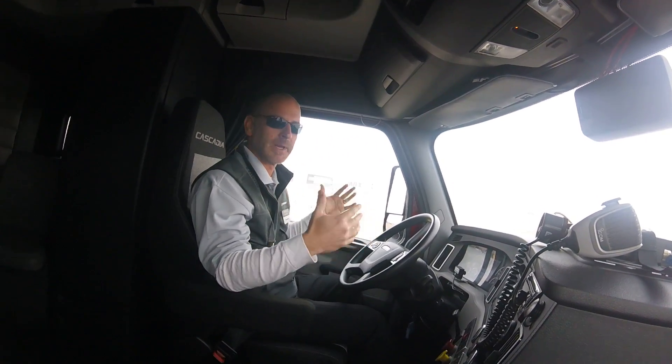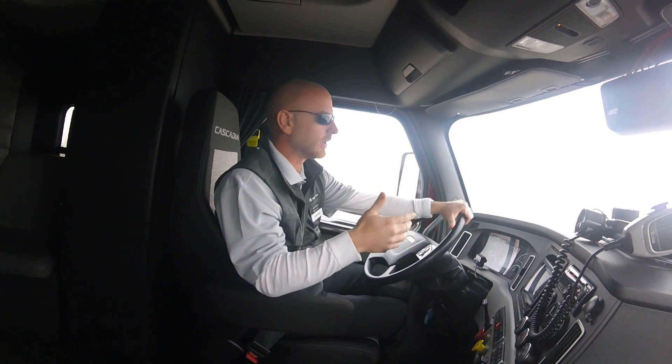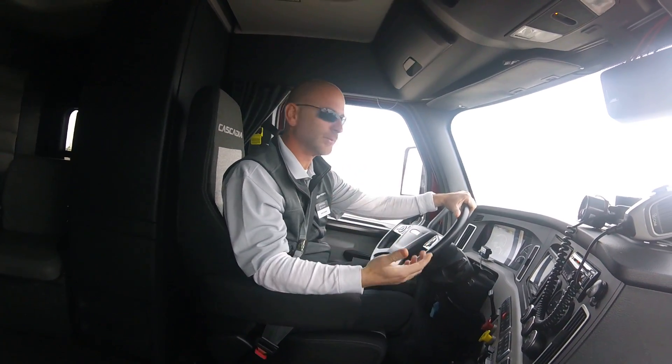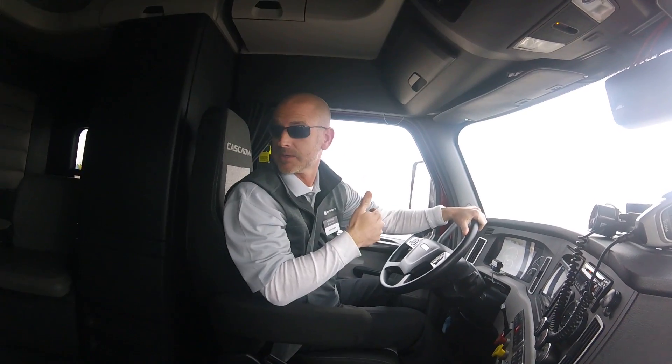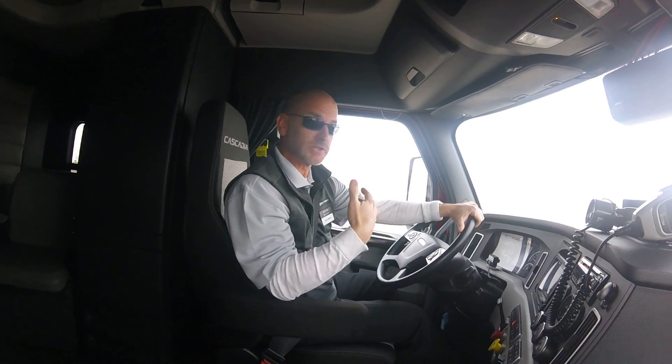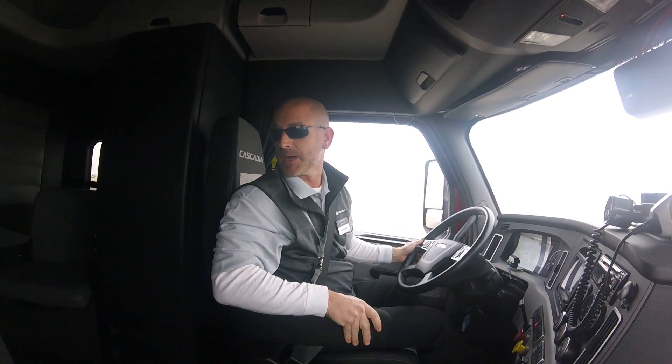This tractor is weighted — we're at about 75 gross. With 2.0 and partial braking at 80,000 pounds, drum brakes, good weather, about 20 miles an hour is what we could bring to a stop on a stationary object. With 4.0, it doubled — we went from partial braking to full braking on stationary objects, and we could do about 40 miles an hour.